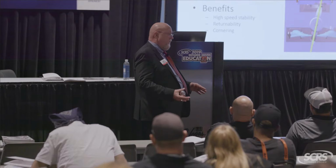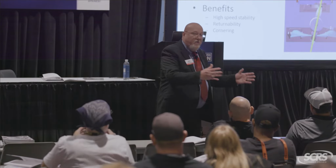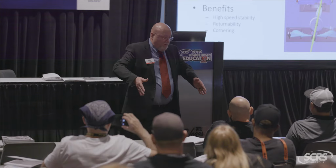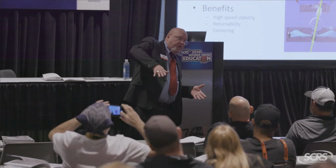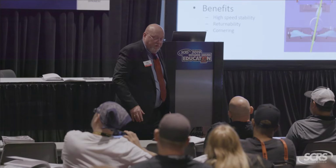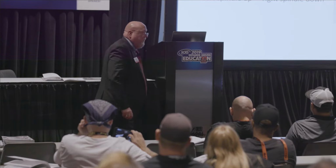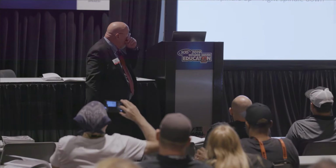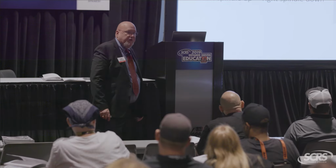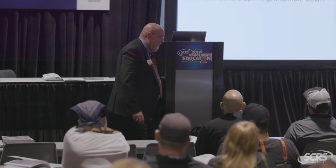Okay, so your tires, when you turn, don't always just go left and right. Camber roll is something in there that's going to change as soon as I turn the wheel. So in other words, your wheels are turning and cambering at the same time. So what typically happens here, there's your camber roll. What typically happens, your inside tire is going to go positive, outside tire goes negative into a turn. Can you see how this is going to assist with cornering? So that's very important to it.